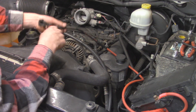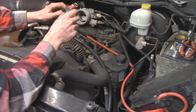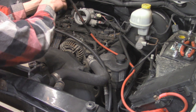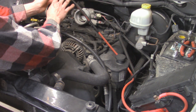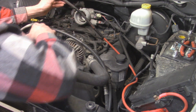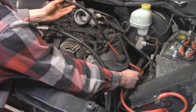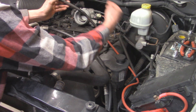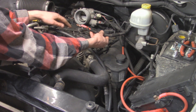For the rest of the alternator cable, I transferred the little plastic connector from the old cable — it slides on the end and snaps down to cover the terminal once attached to the alternator. I also transferred the wire loom from the old cable. I don't have new loom in this size, but having a foot and a half of it on the end near the high heat area of the engine should protect the wire enough so we don't have to worry about it getting too hot. There will be a little bit of slack since the old wire had extra length from routing through a T-joint. I'll bolt this onto the alternator with the 13mm nut after cleaning up the terminal with a wire wheel.